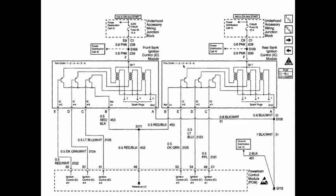This is a six-cylinder engine and each cylinder acts the same way, but for the purpose of this diagram I'm going to focus on just one cylinder — cylinder number two. Here's the number two spark plug, and we have the number two coil that fires that spark plug. The PCM controls the ignition for cylinders one, three, and five, and also for six, four, and two. The PCM output becomes an input for the control module, and that module then looks for the transistor switch for the number two coil.